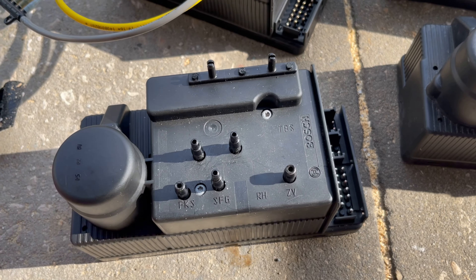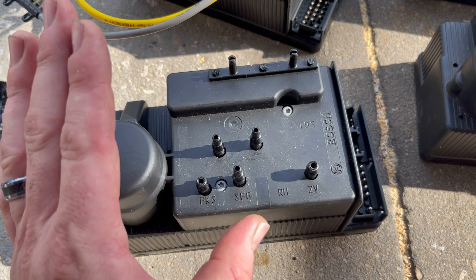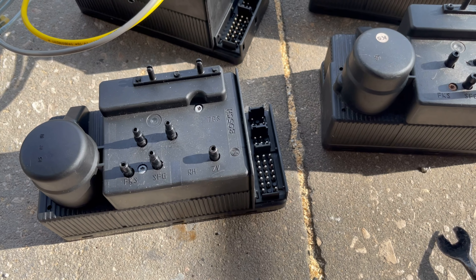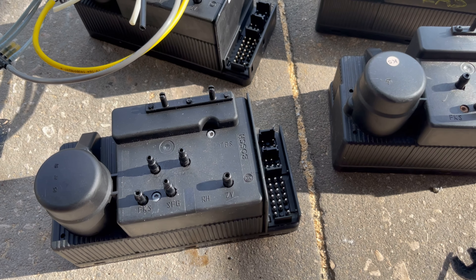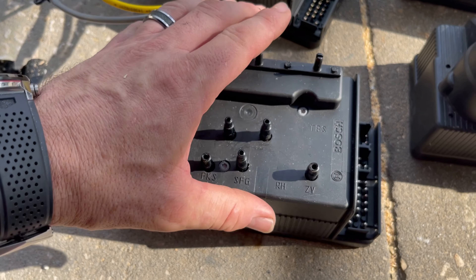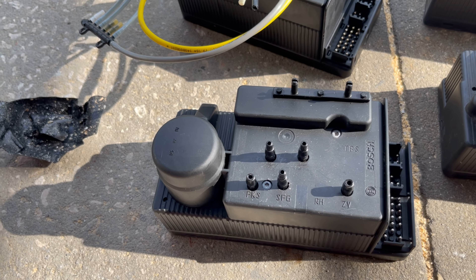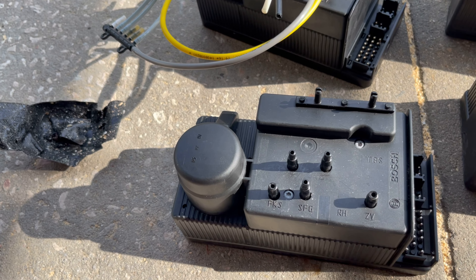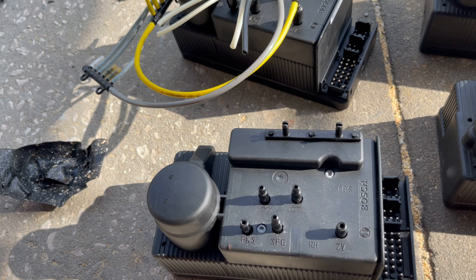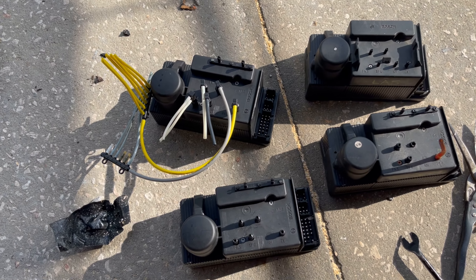The next ports are P-plus and P-minus, which should be on all of them — those are the top ones. P-plus is your lumbar support for the seat. Those bags inside always end up bursting and cause a lot of issues, sometimes making the pump shut down, so make sure they're switched off on your seat. P-minus is your servo manifold vacuum going to the car — I believe the car can actually run badly if this isn't hooked up properly. I've been pulling these pumps in and out for a while and this is the first time I've noticed so many variations.